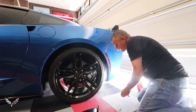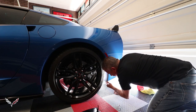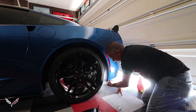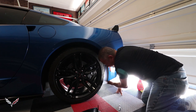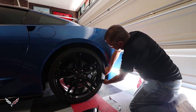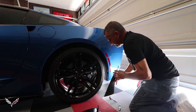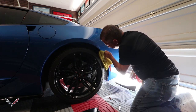I'm just going to reach underneath here. There are three screws underneath — they're all seven millimeter. Two are in line with the outer edge of the car; those keep the valance and everything hooked onto the bumper. There's also a third screw that's kind of inboard toward the center of the car — that's the one you want to pull loose, as that's the one holding the mud flap in place. Once you've got that one out you're just going to reach underneath and pop it loose. Then I'll just wipe this area off.